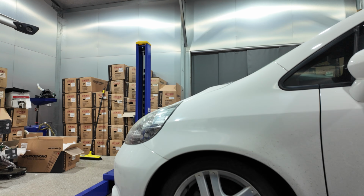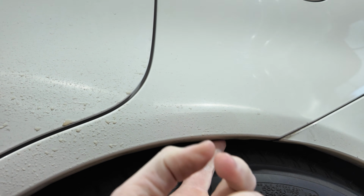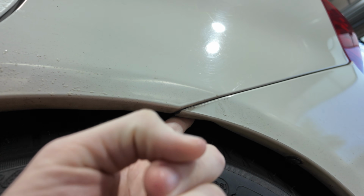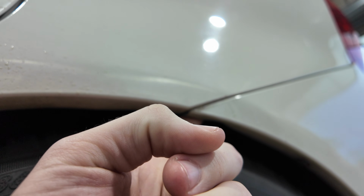We can't leave the new wheels on the back just yet because I haven't got my guards rolled, and I'll try and show you. It will require a bit of rolling back here because this is still pretty firm up, and then up here in this bumper clip there's a little clip that sticks out, and it's got a big triangular edge on that, so I need to shave that down and get the guards rolled before those tuck in.